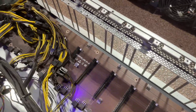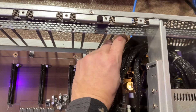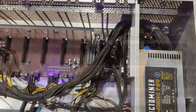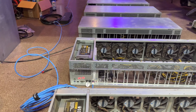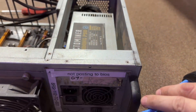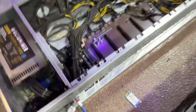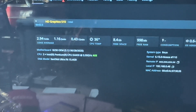Back to the BTC v1.02 — this one was made in 2020, so I'm guessing that is indeed a replacement board. I'm going to pull the mSATA out because I do not want to boot into his old HiveOS farm, I want to boot into mine. We've got flashing ethernet lights and they just turned off, which means if they come back on it's pretty likely they were booting into Hive — a great first sign. And I did see on the front of this one 'not posting to BIOS' — yeah that seems accurate. Ethernet lights are back on, let's check Hive. Everything comes up okay.